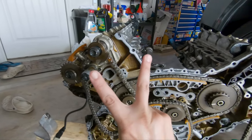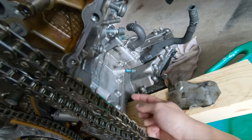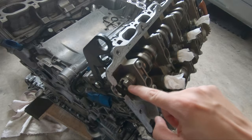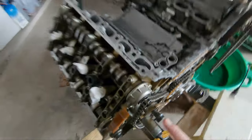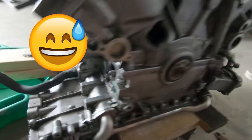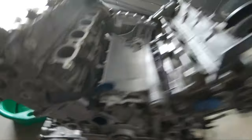When you do this, you need to do two things. There's a crank pin that you unscrew and put a lock pin in to hold the crank in the same spot. While doing that, you have to have somebody on the other side of the cam holding it with a one-inch wrench as you're loosening or tightening it. But because this piston is holding my crank in place, there's really no need for that crank pin or the wrench, so I was able to just loosen it up.